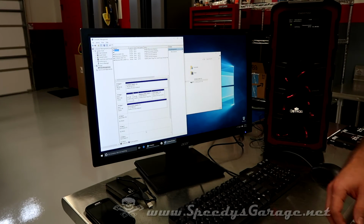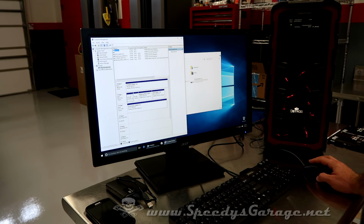That's basically it. The next thing I always do is go in and set my hard drives up, and you do that through your storage disk management interface. I set up the primary storage drive as a 2 terabyte RAID 1, gave it an E drive letter. This is the main system drive, that's the 2 SSDs. Windows 10 by default gives you a 450 megabyte partition, at least on this drive. Looks like it does 10% maybe of the drive as a reserve, a health system partition of 100 megabytes.